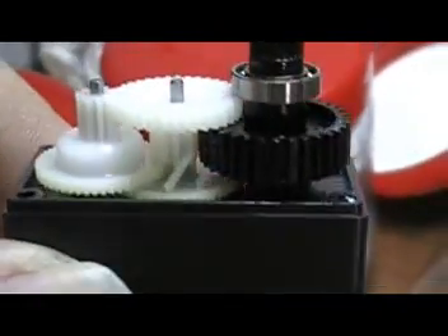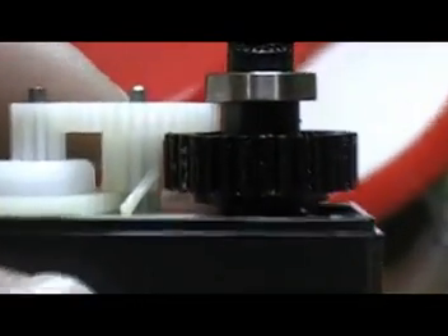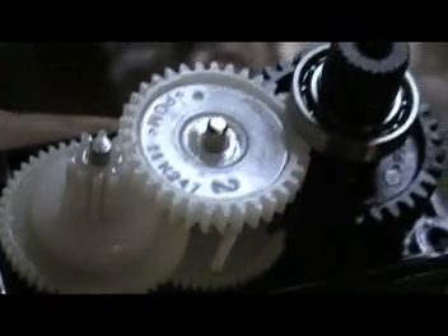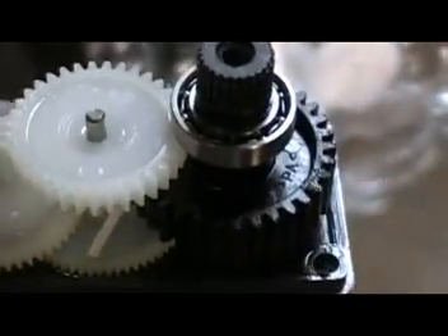I found the gears — the black one is the primary, then secondary, third, and fourth. The secondary gear was stripped. You can see a tooth was stripped. I found the residue, the remnant of it. Wow, very clear — I'm using the camera as my magnifying glass. There's the second gear, right there — stripped.